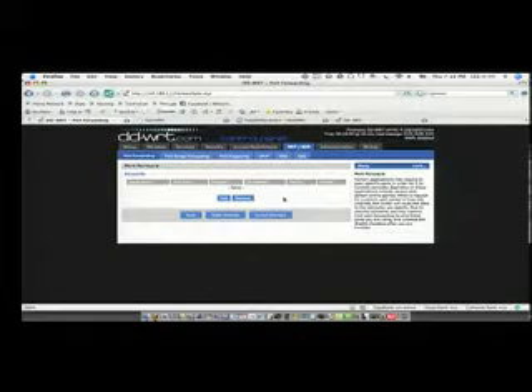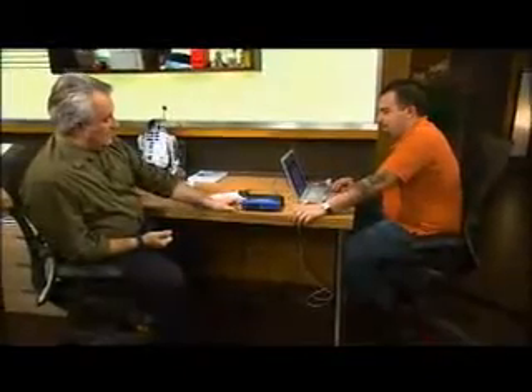You can also subscribe to Hotspot — you can actually make yourself a hotspot. You could set up a little business on the side. If you're in a downtown area or you're a hotelier, it's got its own login page. You don't have to go to an expensive service. I also saw it has QoS — Quality of Service. You can sit here and say I only want this specific port to have this much bandwidth at this time, so you can prioritize Skype, torrents, or web traffic. The list goes on — we've just scratched the surface. You can also turn the wireless feature into a bridge, so if you've got another wireless device this can just be an extender — you don't even need a network cable connecting back. This is DDWRT, one of many OpenWRT implementations to hack your router.